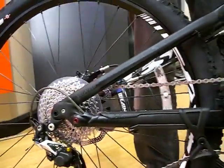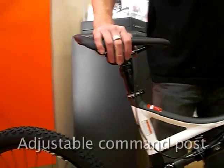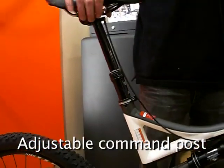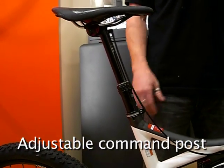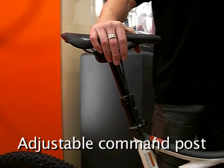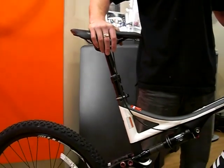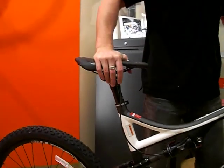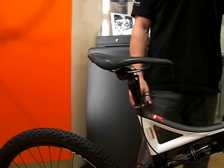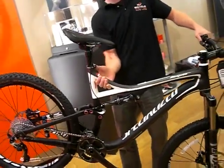This bike is also equipped with a seat dropper post. This is the Specialized Command Post — with a push of a button it comes all the way up to your full climbing position. And then you have two more positions: your halfway position, so if you're going over uneven terrain but you still want a little bit of climbing support you have it there. And then for full descending, you can push it entirely into the frame, so you're not bucked over the handlebars when you're clearing big rocks, roots, or trees.